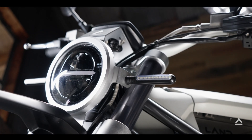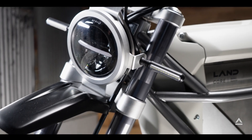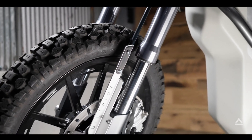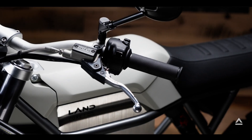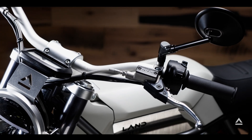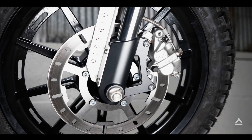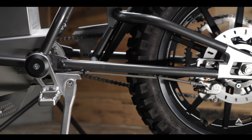Let's go over the rest of the bike, starting at the front forks, which are a cartridge dampening coil spring. Front fork travel is around 120 millimeters or 4.7 inches. This bike also features front and rear Magura disc brakes — the front brake is a Magura HSQ dual piston 24 millimeter cylinder, and the rear is a Magura HSQ single piston brake.